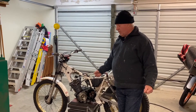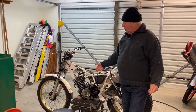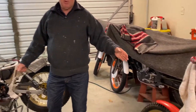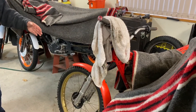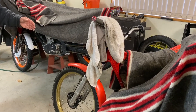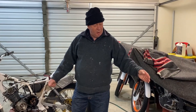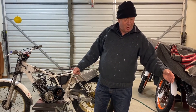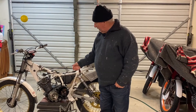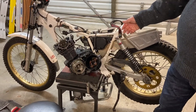A couple of issues came up later on with these bikes. Mine started to rattle a little bit and just got progressively worse until I decided to do something about it. Christine's on the other hand started to smoke a little bit on startup — we put that down to oil seals on the valves escaping down and burning oil. This bike had originally had a slack timing chain, so we put a new timing chain in, but we did not do that on Christine's bike — it just made a rattle.